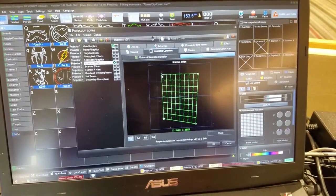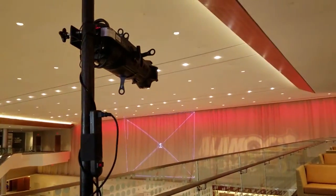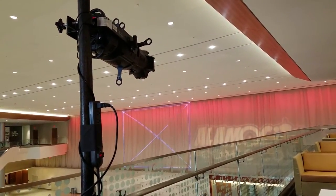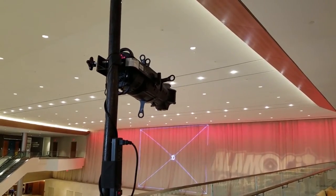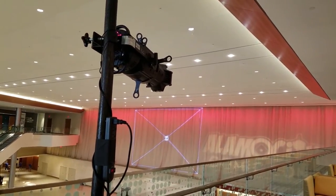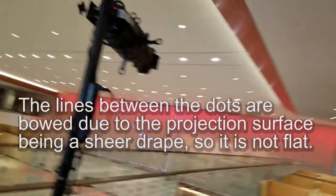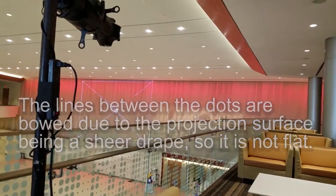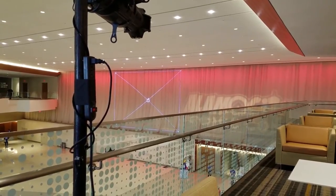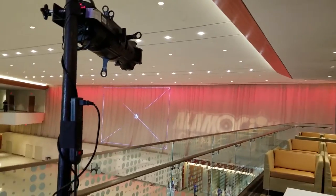Same thing with my top left and top right corner — we're going to select the point, eyeball it in with the mouse to get it into roughly the right position, and then walk it in with the keyboard. The idea is you want the dots in the corners to line up as much as possible. We're not too worried about full side alignment because we'll adjust those when we move to the crosshatch. The last one is the top right corner — walk it in, and we've got a good ballpark approximation.